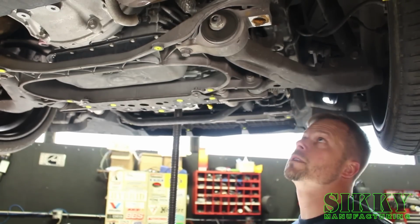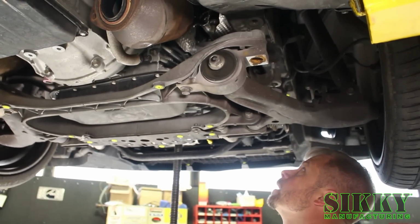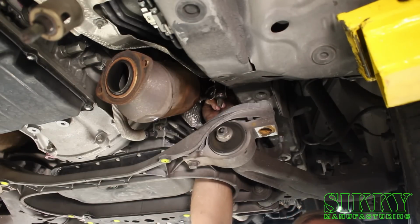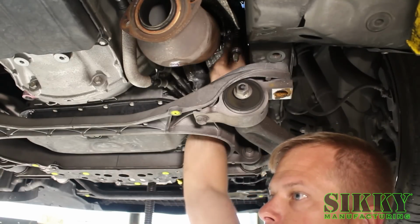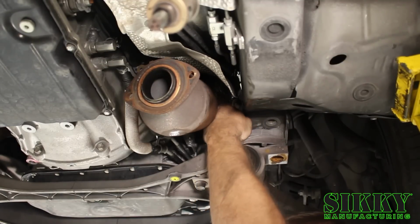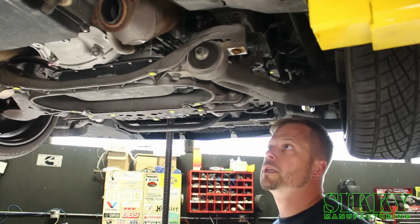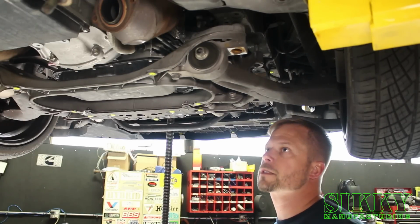The passenger side has three 10mm bolts holding the heat shield on. Unfortunately, they put one on the front side of the manifold behind the alternator, which is tough to get to. It's doable. I recommend a ratchet wrench. Now that we got the heat shields out of the way, it's time to remove the 8 12mm bolts from each manifold and take the stock manifolds out.